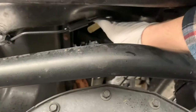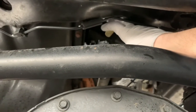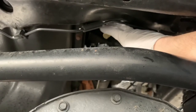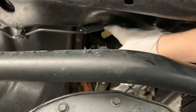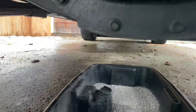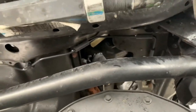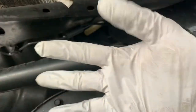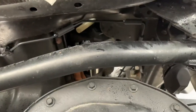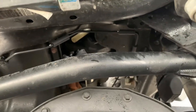That tube right there is where the release valve drains to. You can put a bottle there to catch it — that's fine. But when you open the top of the fuel filter, you're still going to have some fuel drain out, not through the tube but from the filter itself. That's why you want a catch pan. I'm just going to put it directly underneath to catch everything. Also, wear gloves — you're going to be dealing with diesel fuel and it'll dry out your hands.